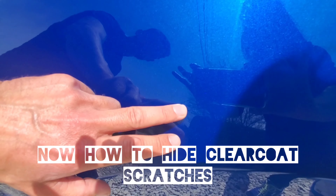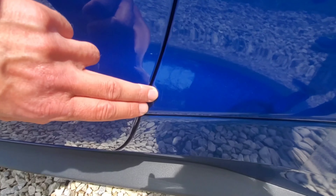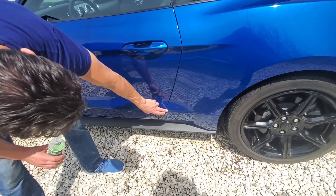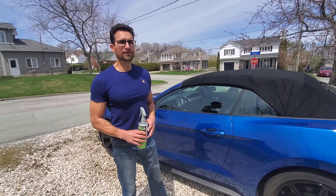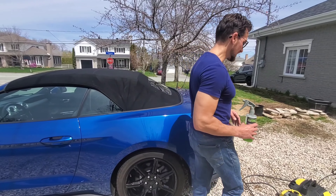Now that scratch is quite well hidden, and I actually had quite a bad one down here. That's going to be a scratch that requires detailing — compound will be my first test. I'm going to compound just this section, and if compound doesn't do it, I may have to fill that in with either some clear coat or some paint. But for regular clear coat scratches...